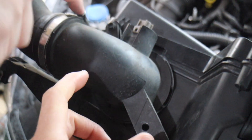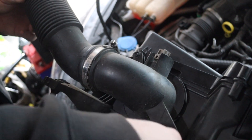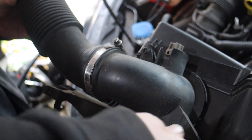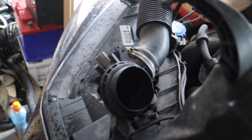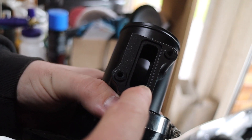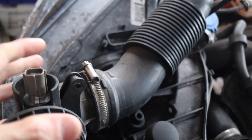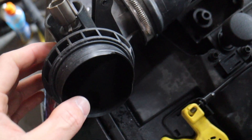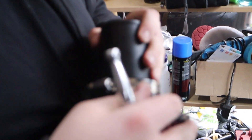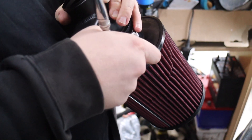So we have our first issue straight away — it doesn't look like the MAF adapter is going to fit on that. Look at the opening on that, and then look at that. So what we're going to have to use is the stock elbow — we're going to have to use just this bit. I know it doesn't look as good as the AirTek one, but we're going to have to stick that on the end of there and use the stainless steel Jubilee clip.